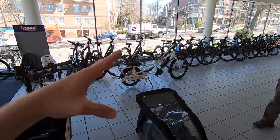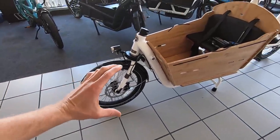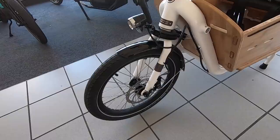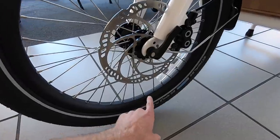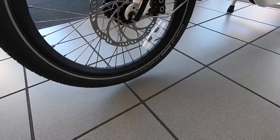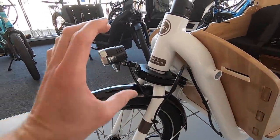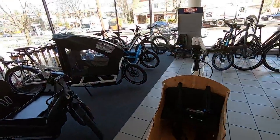The Spicy Curry over there has a larger front wheel, lower attack angle, a little smoother — it might span gaps more easily. This bike might not be quite as comfortable because of the smaller wheels, but the long wheelbase helps provide comfort. There's a steel fork, so it's very sturdy but also vibration-dampening. Great stopping power with the quad-piston calipers, larger rotor, reinforced rim eyelets, and Schwalbe Big Apple Plus tires with reflective sidewalls. It's a white frame that'll stand out. The lights have a blue-line design with side windows, pointing where you steer.